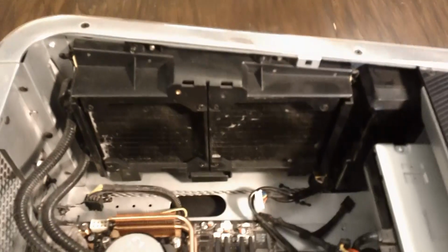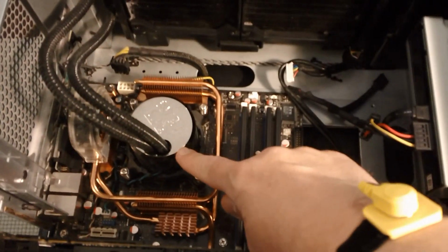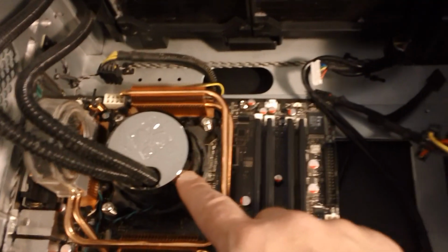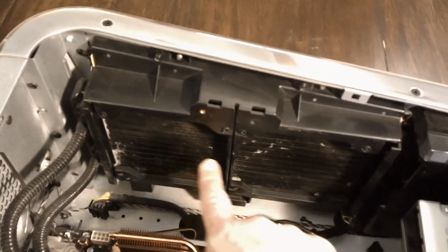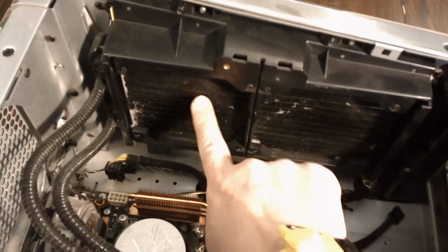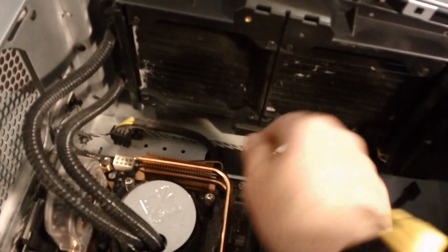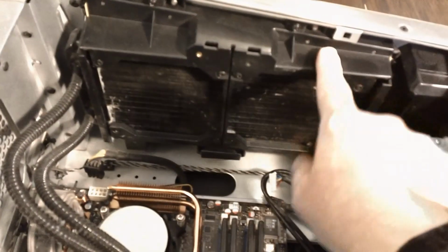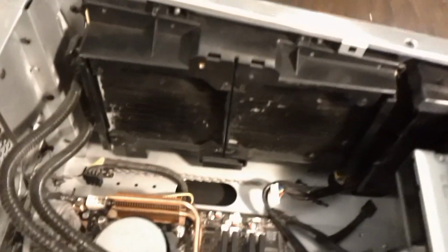The radiator setup is a little strange with the Blackbird. The header, the cooling header, appears to be a standard H50 Corsair with a little bit of chromed metal stuck on top with the Voodoo logo. But the radiator setup is different. There's one radiator on the H50. This thing has one big radiator, which kind of resembles more the H100. So, just removing this and looking at it, it was not clear to me how you would replace this radiator. So that may be a system limiter in terms of how you do that.